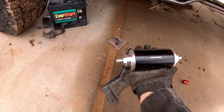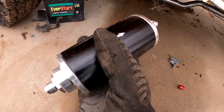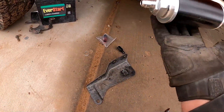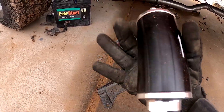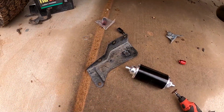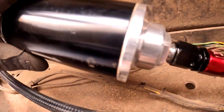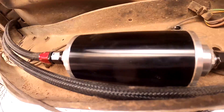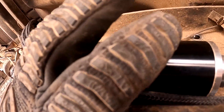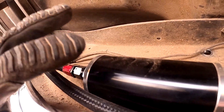One thing I had forgotten is the fuel filter. The fuel filter is going to go on the inlet side of the AN hose — it's an AN6, I think it's a 100-micron fuel filter. We've got to cut our hose in half, add two AN fittings, and screw it in. I also have a separate mount that clamps it onto the frame of the truck. The filter is directional — you can see the arrow — and I'm 99% positive this is my feed line. I wanted to get this fuel filter on so that when we start putting gas in, it'll at least be filtered.